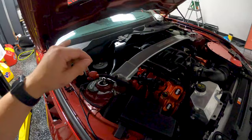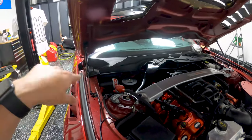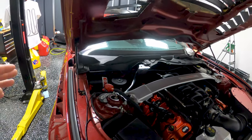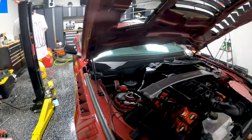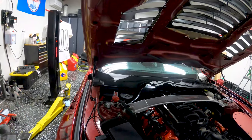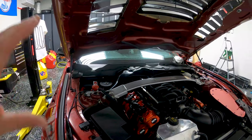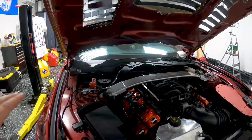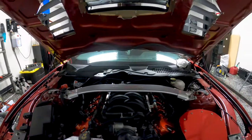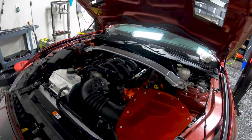One other thing I'm going to add is a little gauge from Speed Hut that will plug into the canister and tell me the vacuum level - I'll put it inside the car. The great part is it's an electronic one with a warning light. I can set it so when vacuum drops below a specific threshold, a little orange light flashes and lets me know. So even if this setup doesn't fully fix the brake issue, I'll at least have an idea going into a corner if I'm not going to have enough vacuum. Plus that'll help us figure out if I have a dead pedal but plenty of vacuum, so we'll know exactly what's going on.